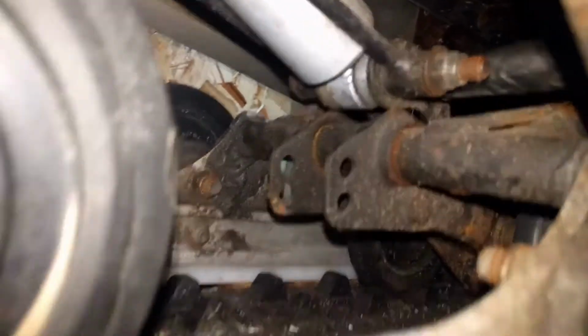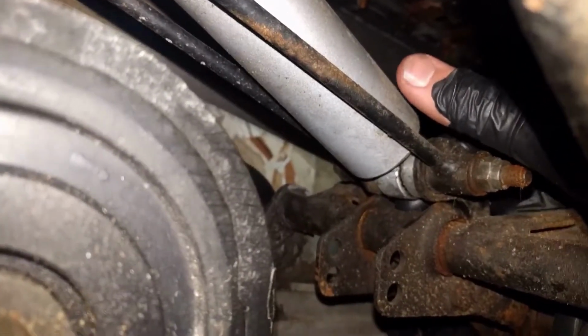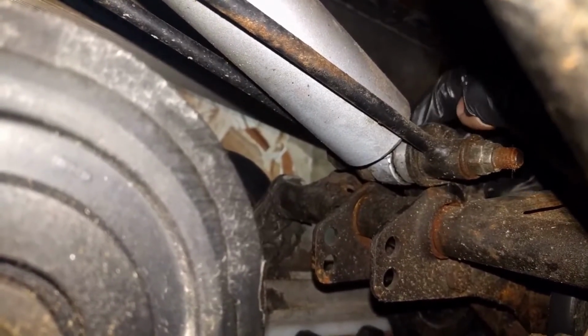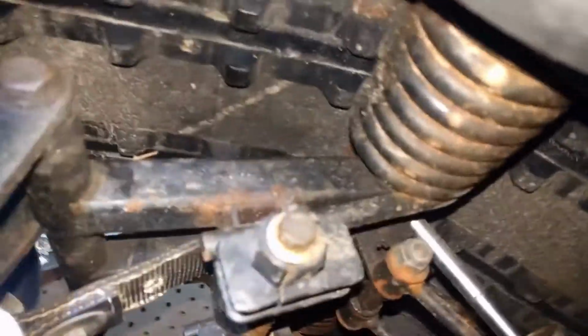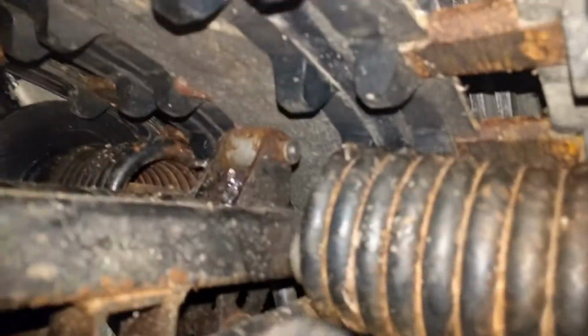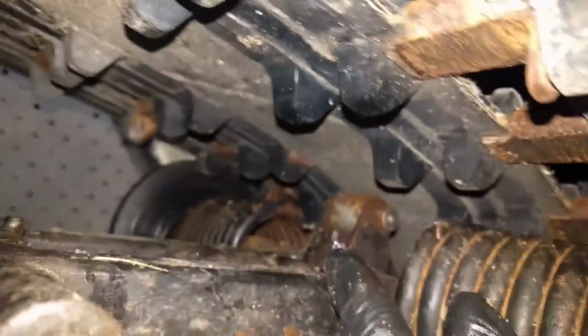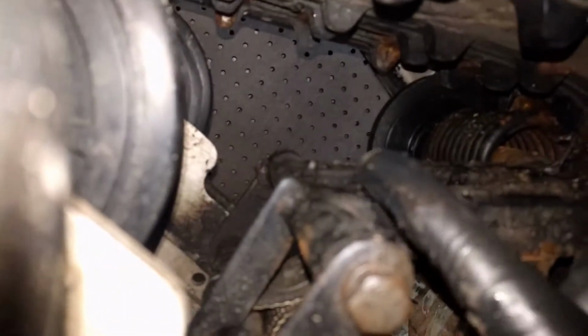Coming back, this is your rear shock. This is the lowest point of it. Here you have a shaft. And sure enough, let me hold the camera with this hand. You can see my pointer finger down underneath the shock. I can feel the zerk right under there. Right under the base of the shock, there's a zerk. You've got this upper spring thing. Bunch of grease. Inside that pile of grease, there's a zerk. You know, horizontal bar going across. Another horizontal bar here, zerk.